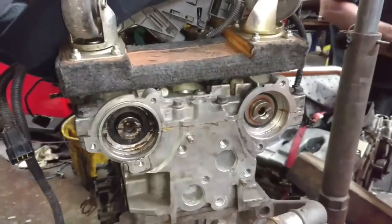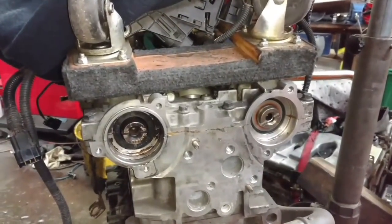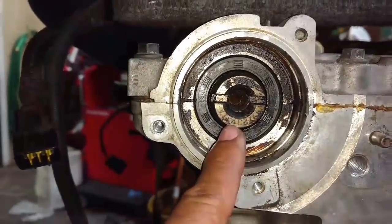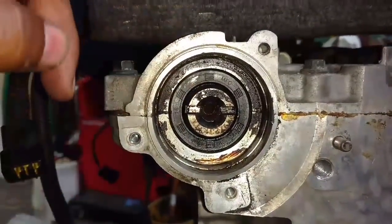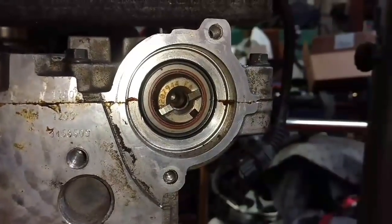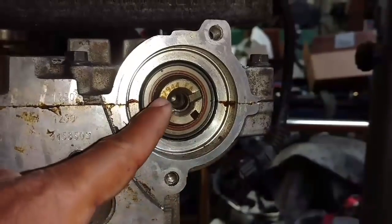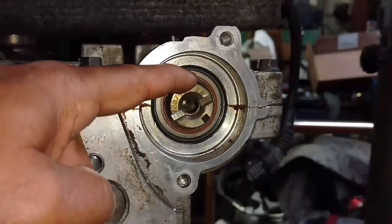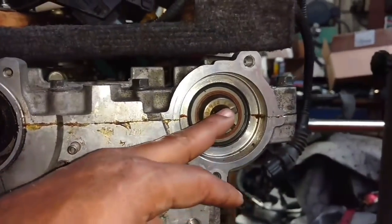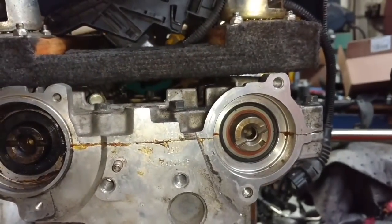This engine came out of a '99 or 2000, an earlier version of the ones with the VVT hub. The intake cam here has the numbers along the bottom of it. The slot is actually offset to the top. This is the exhaust cam. The slot is offset to the bottom — it has a notch in the bottom. The numbers are going along the top of it. If you had to put the locking tool on, this would turn a little clockwise to straighten this out and that timing mark can still be on.